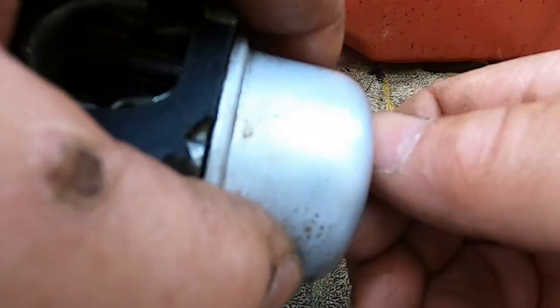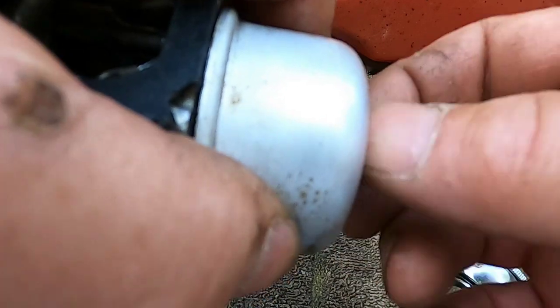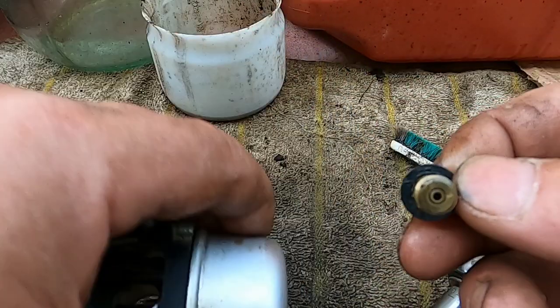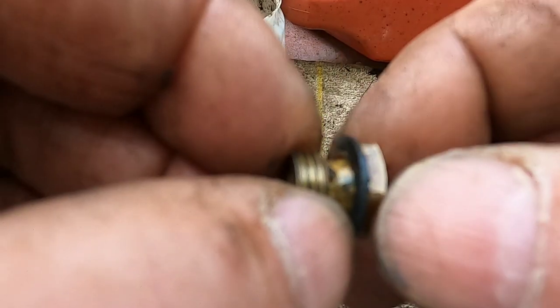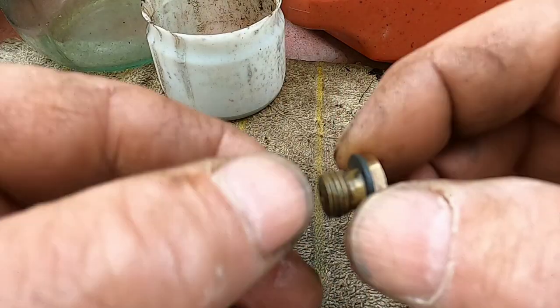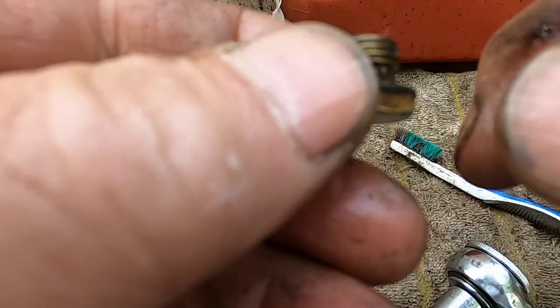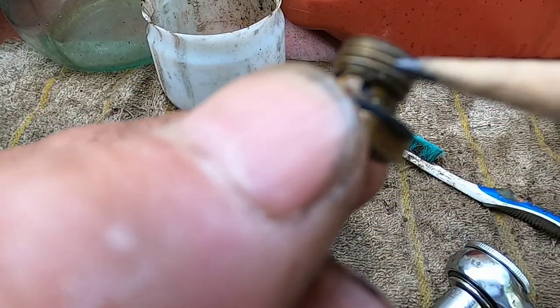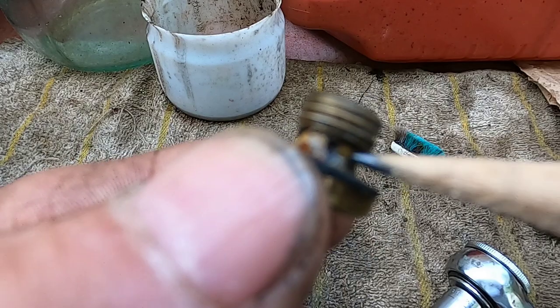I don't expect to see too much that's bad — let's see what we have. Wear a pair of gloves while you're doing this. When putting it back together don't forget this washer over here — it'll have a leak if you don't put it back on. Let's look at this — this is your main jet. Look how clogged this is; this is why it's not running. Some of these have an opening right in the thread on top — I don't see it on this one, but this is definitely clogged.